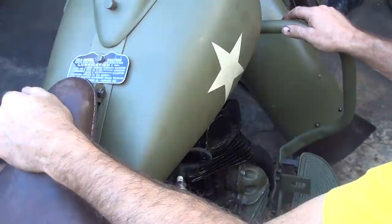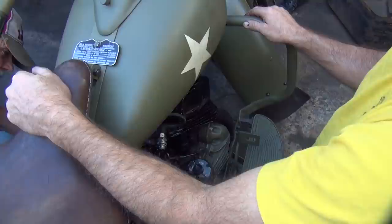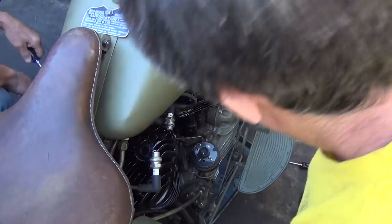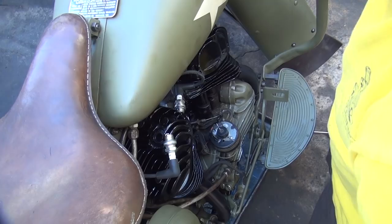I'll put the screwdriver in there, just look. You can't see. There's no line. Oh, wait. It's all the way to the front of the hole. Did you put the screwdriver in the hole? Yeah, in the slot. You get to redo it. I told you, don't put the screwdriver in the hole because it moves the flywheel. It doesn't give me an accurate number.